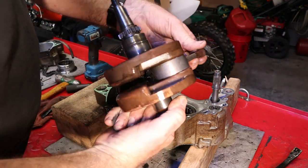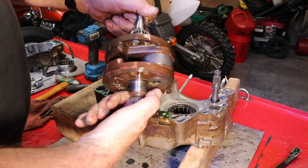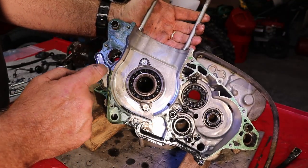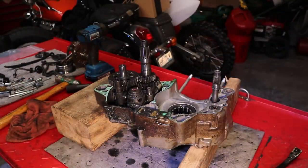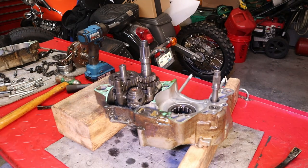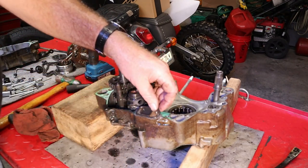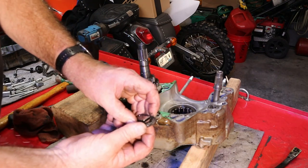There's our crankshaft bottom end — looks good, no signs of oil starvation. Outside of the top, that's the only reason it's getting replaced. This is where the oil pump runs and it looks pretty good — this is a 2005, so a 17-year-old motorcycle. This serves a very important purpose on this bike: this is a reed valve, which is nothing more than a one-way gate.